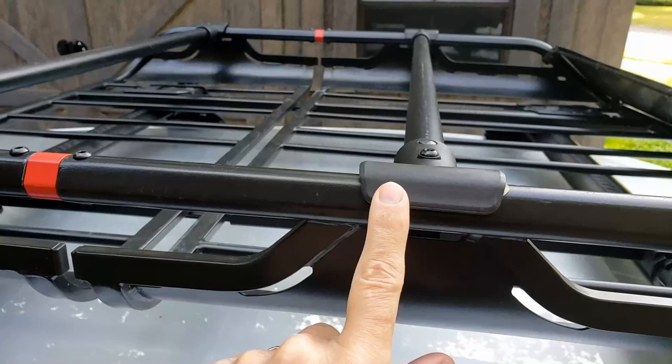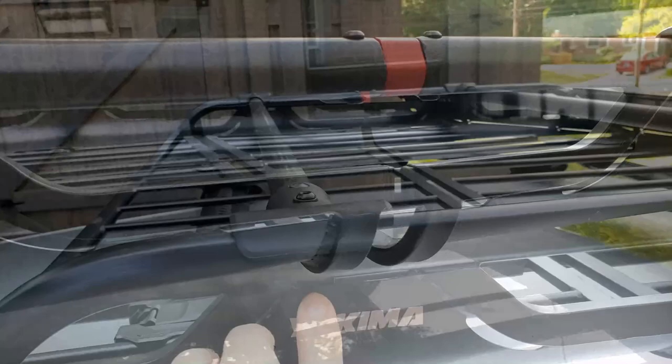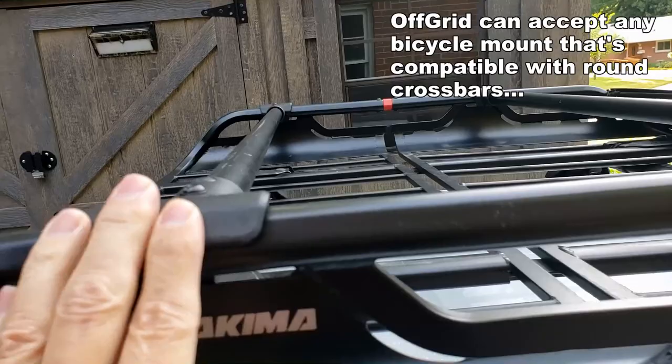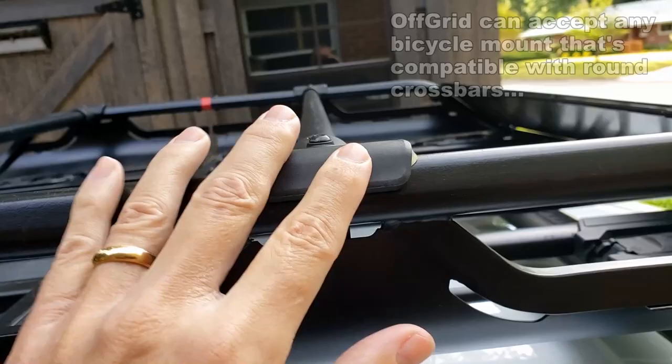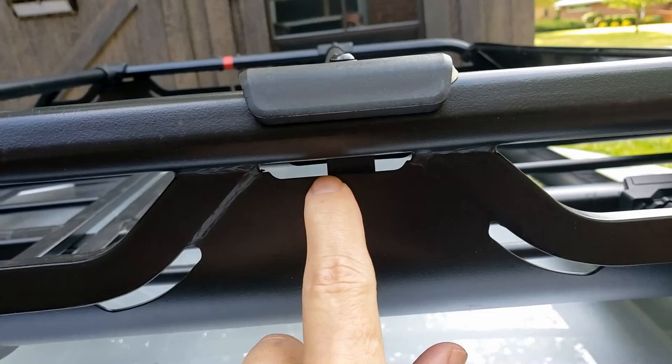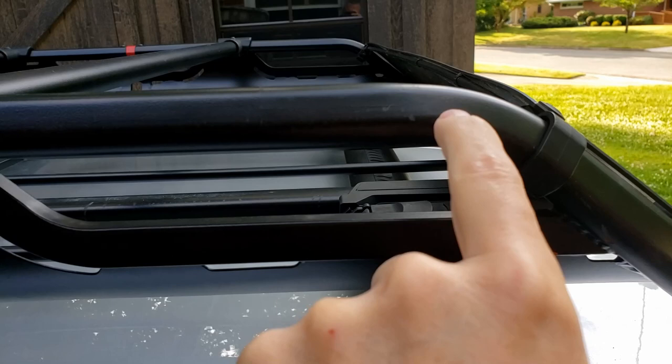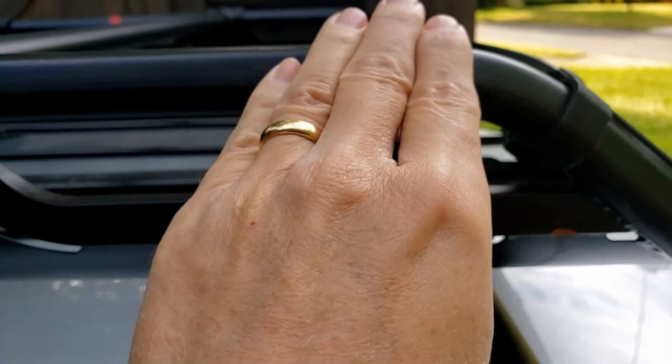The carrier also has a couple of crossbars. They are right now set up in the positions where they are mechanically strongest. Yakima insists on having the rear bar in this position so it's locked in any time you have a bicycle mounted. The problem I had with it when I put coolers in here is the weight of the coolers was actually able to push this bar. If it wasn't locked into one of these positions — let's say I had it up here — it actually pushed the bar forward with a 40-pound cooler. So what I want to do is put some self-tapping screws about right here, just tap it in, and that would serve as a block so the bar cannot push forward. That's a plan I'll do in the future — it's not immediately necessary.